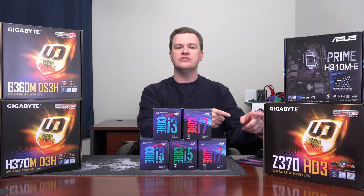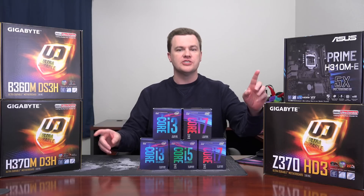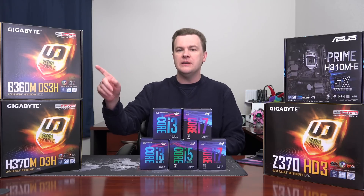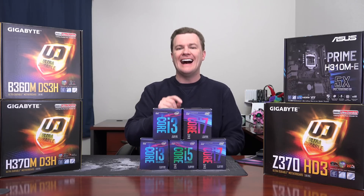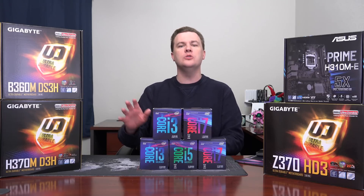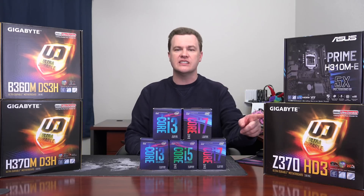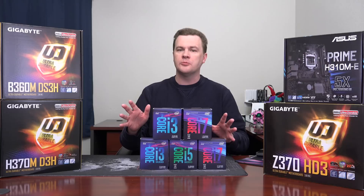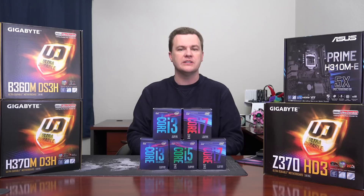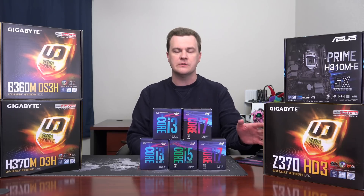When it comes to motherboards, last year just the Z-series launched, but now we have 4 different chipsets. Skip the H boards. You want to buy a B360 board if you're getting an i3-8100 or an i5-8400 — I recommend the i5-8400 out of those two. Anything beyond that, K chips or any i7, just get a Z370 board. There's only about a $30 price difference between the cheapest Z370 and the cheapest B360, and given all the feature differences, if you're going above about a $170 CPU, just get a Z-series board.